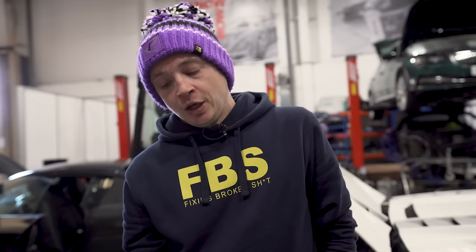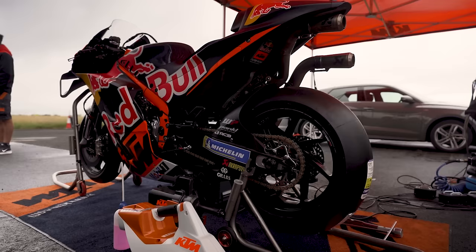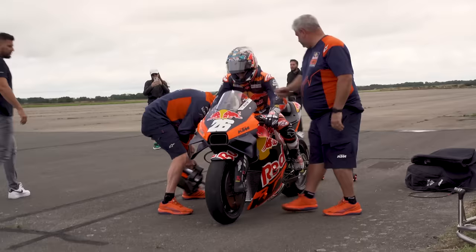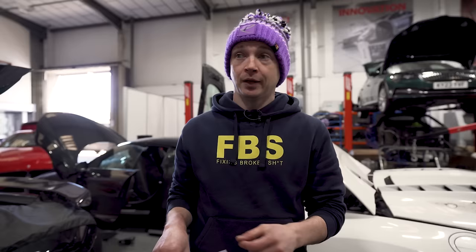You kind of have to split it into two things: you get sprung aero and you get unsprung aero. Where you see the bikes with massive wings under where the headlight would be and big wings at the back — that's load you're putting through the suspension, so you've got to factor that into all your suspension calculations. Unsprung aero is where you see little wings and vortices hung off the suspension or the swing arm to try and help load the tyre into the floor. Ultimately what you're trying to do is cheat grip — generate more grip, the same as in F1.